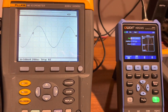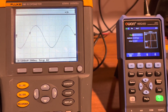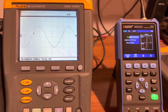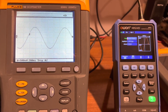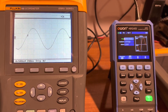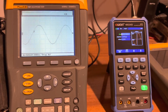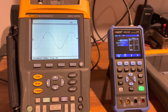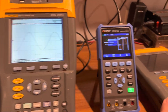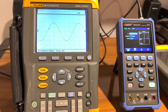The only problem with it is the display, which they all have. I did somewhat fix the display, but you can see there's still lines that come and go. I actually have to send it out to get it fixed properly, because trying to do it at home with a homemade hot bar is only a temporary fix. There's a company that replaces the cable with new conductive glue — that fixes it permanently, but it's about $200 to send it out.